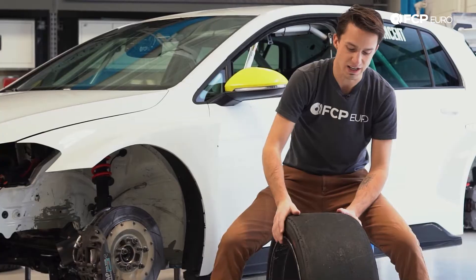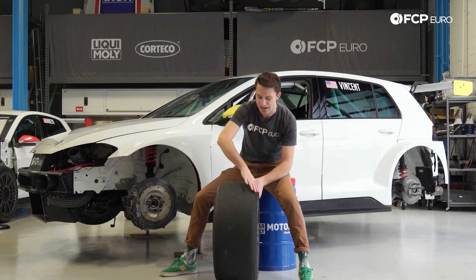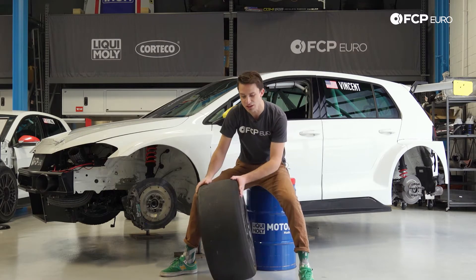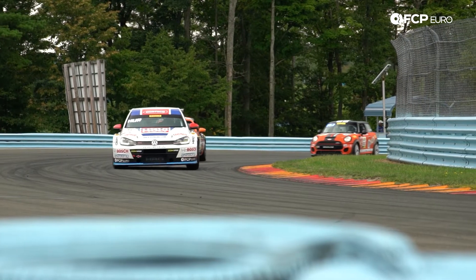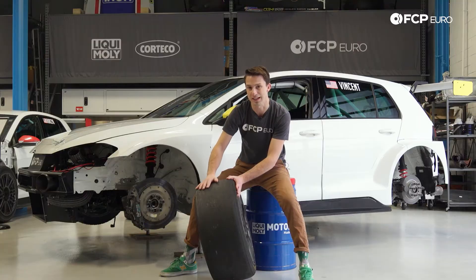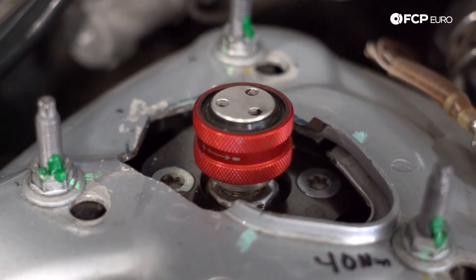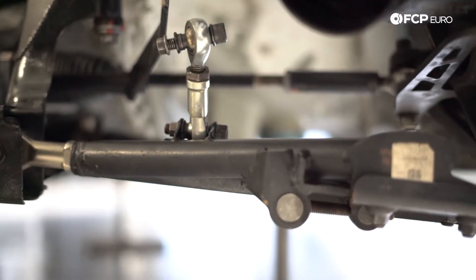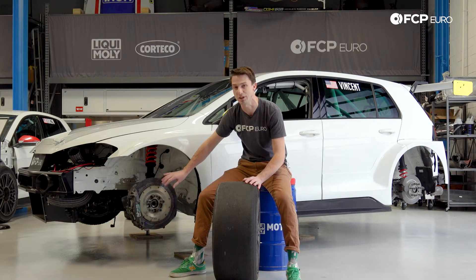The reason for this is that when the tire is loaded up and the car is going around a corner, that tire contact patch basically distorts to the road. If we lean the wheel, when the car is at full cornering force and the tire is distorted, the contact patch is sitting flat against the ground, giving the car the best handling and the most cornering force. On a race car, you typically have camber plates up at the top or adjustable control arms, giving about five to seven degrees of adjustability in the camber.